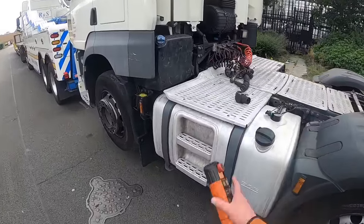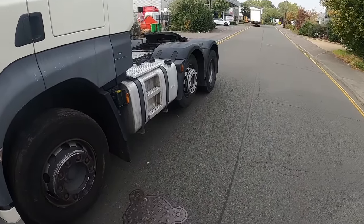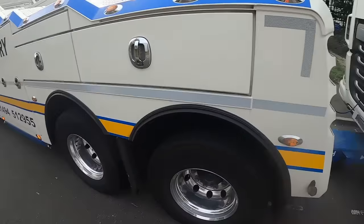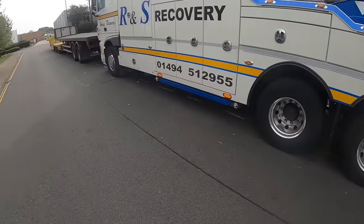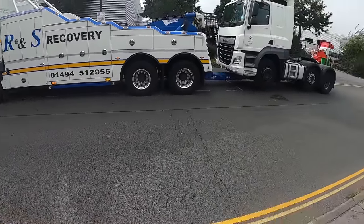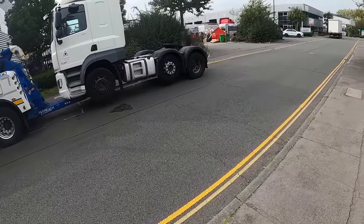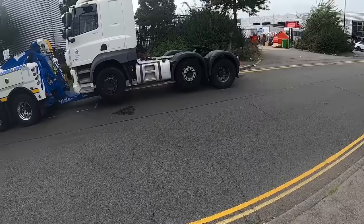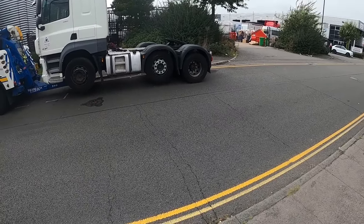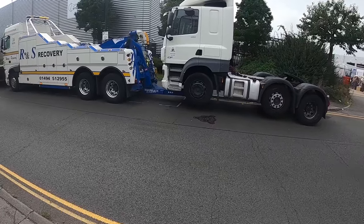It seems to be a gearbox fault with this, so it will move a little bit into the garage. We're just going to drop it off now. So refit the half shaft for them to drive it in. I won't actually seal the half shaft; I've advised them that we're not resealing it. We're just refitting the half shaft and torquing it up so it's tight.